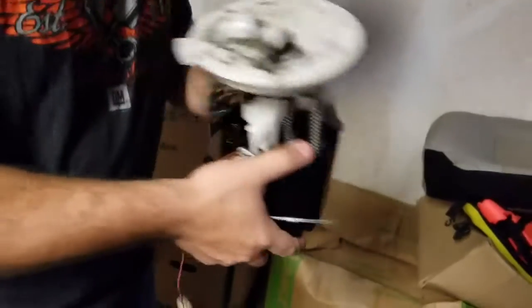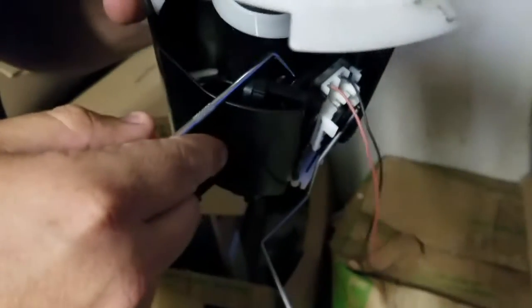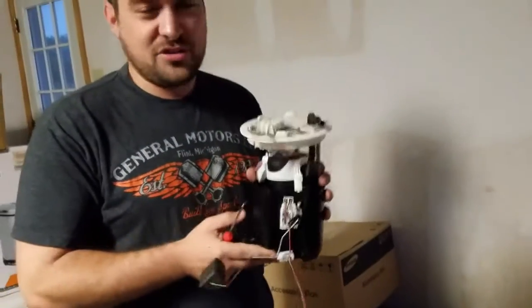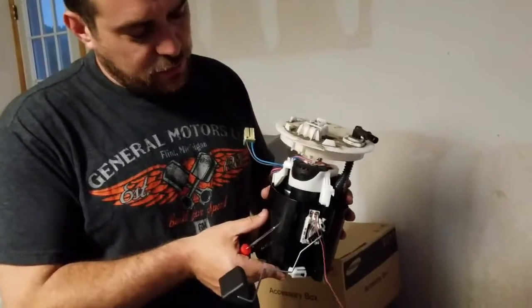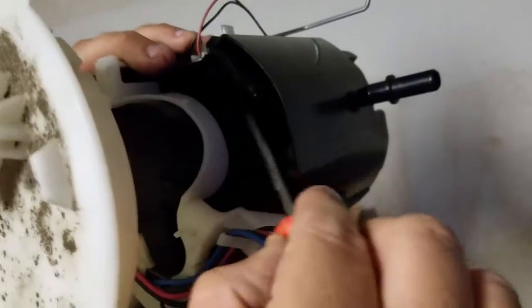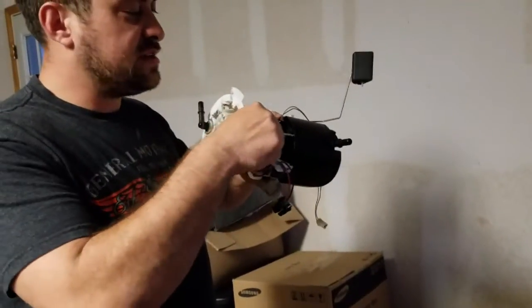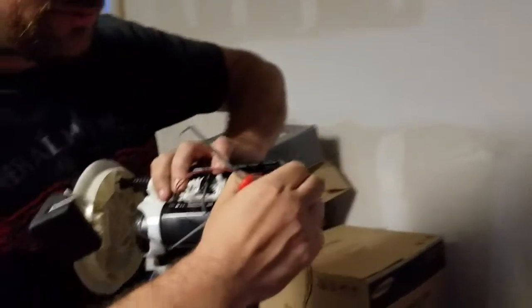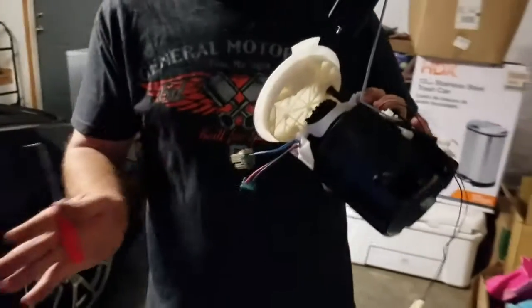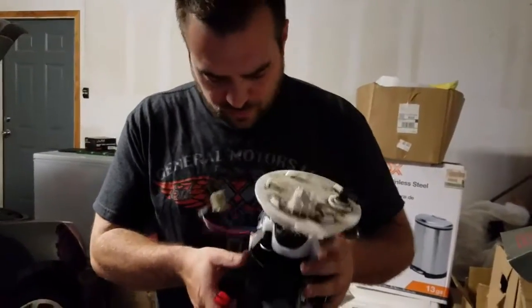Here's the key to this whole thing. There's a black hose down in here — it's small, plastic, and has a very fragile nipple on it. It will break off with very little pressure, and if it does, you will be buying a whole new unit. It's not cheap, and you won't find one in the junkyard, so don't break it. Before you pull it out, you'll notice this little thing right here — it actually has four clips, one on each corner. If you get a set of these, you can easily reach down in there, especially with an extra set of hands, pop the clips, and pull this whole unit out. Make sure you pop the bottom half off first before you do that. That way you can pull this out with this, keep it all together, and you don't have to worry about breaking anything. No matter what any other instruction says, this prevents you from buying a new unit. Always do anything preventive like that.